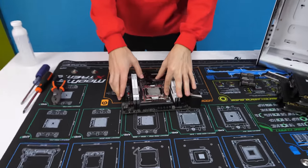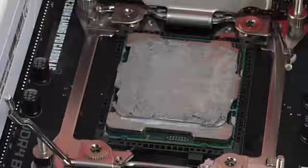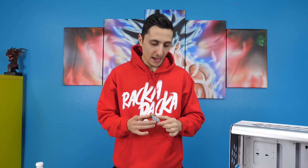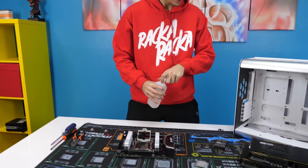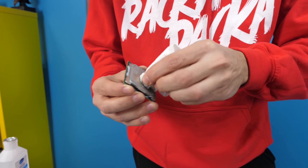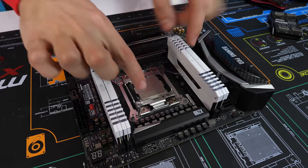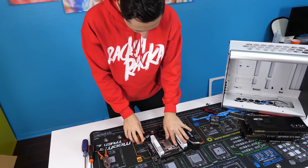Let's go ahead and take off the CPU and clean it real quick because it's got the previous thermal paste on it. This is the 7980XE, guys — an 18-core processor. This is actually delidded thanks to Stephen from Gamers Nexus, so it's going to perform a lot better. Temps are going to be better, which means I can push the overclock on it further than a stock 7980XE. Very excited to see how much I can push on this once it's water-cooled. This thermal paste is so hard to clean — this is from Thermal Grizzly. I guess that's why it works better than other thermal paste.